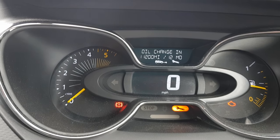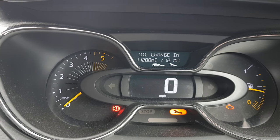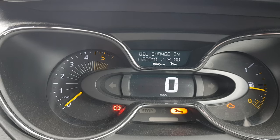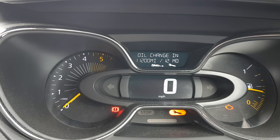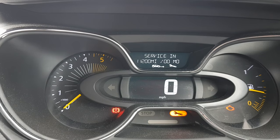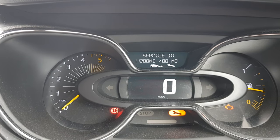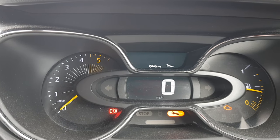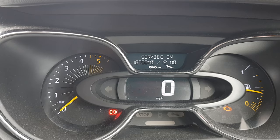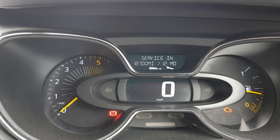You can hit it up once and you can do the oil change. This will be the same for the oil change or the service reset — I'm doing both today, so I'm going to reset both of them. We're going to change the service one here because clearly it is out of sync. Press and hold the top button again at this point and it'll start flashing. Wait until it changes — that's it, reset. Let go, press it again — that's it, reset.